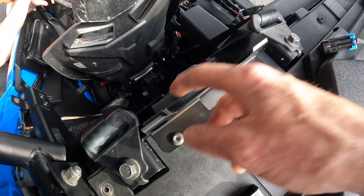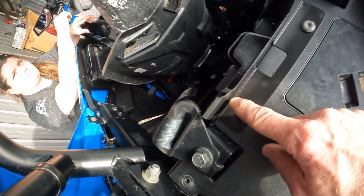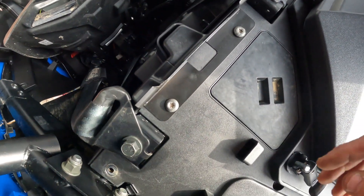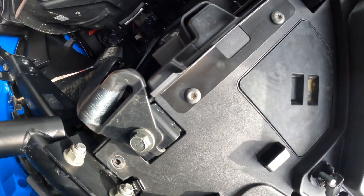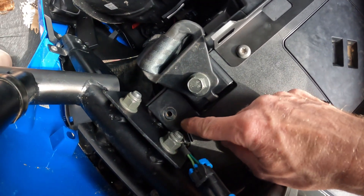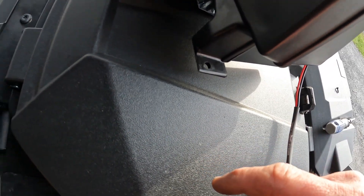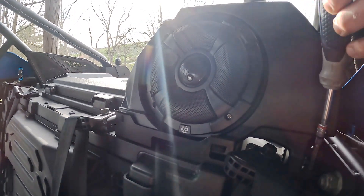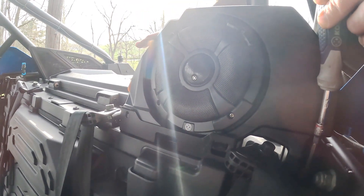We'll use the one bracket with the cutout for the bump-out on the front of the speaker, which goes into this hole here. This side has a screw hole which gets screwed into the screw hole at the front of the speaker. You mount that bracket with the two Torx 40 bits into the top of the plastic, then put the speaker in place. There's a Torx 40 bit that goes in here to hold down the corner of the speaker. We dry-fitted the speaker back onto the bracket. Once you first put it on, it's going to feel like it's not sitting right — it'll get pushed forward a little bit, but once you start putting the screws in it'll pull it forward.